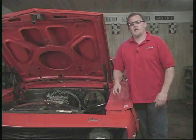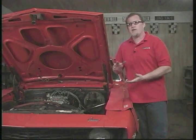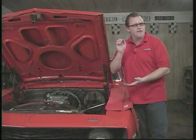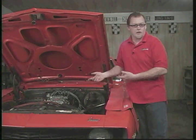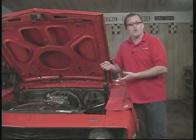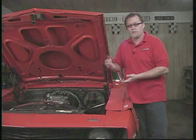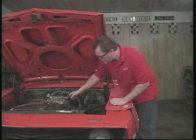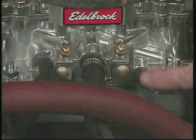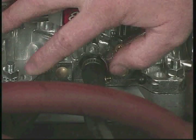Another problem you can run into is when the engine runs just fine normally, but you've got a little bit of a high and erratic idle — and when you're cruising down the road and give it a little more throttle, you get a pinging sound. What that's telling you is you probably have a vacuum advance, and chances are it's hooked up to the wrong vacuum port on the carburetor. Most vacuum advances use ported or timed vacuum. If you hook the vacuum advance up to manifold vacuum, it'll pull too much advance at idle and ping under part throttle. The lower port down here is manifold vacuum — fire the engine up and stick your finger on it; manifold vacuum will suck your finger on. Ported vacuum really won't — there's almost no vacuum at idle. Most vacuum advances use the ported side.